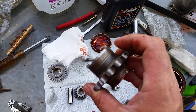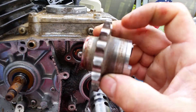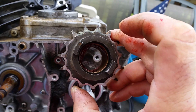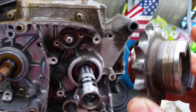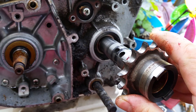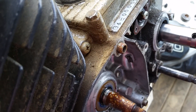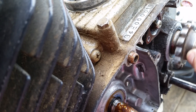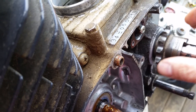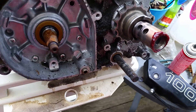The gear has two cogs on the end — those two big pieces stick up, then there's a smooth spot. The cogs are going to go into the gearbox facing outwards, so this fits right on the shaft like this. Rotate it a little bit to get that grease moving and it's into the seal. It feels good — no binding on the shaft. Right now it's in neutral.